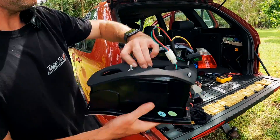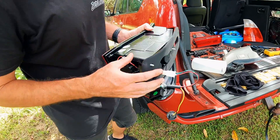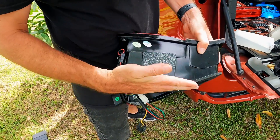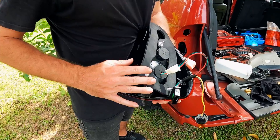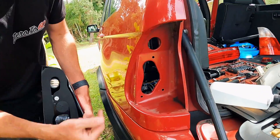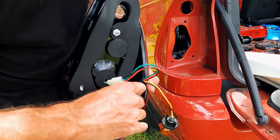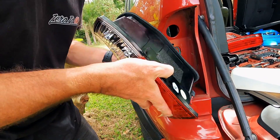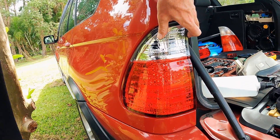Keep in mind it is only this rubber seal that seals it against water. If that rubber seal doesn't seal against the paint or body of the car, you will get water leaking in. Fit them up, try and get the rubber to sit on the plastic and make sure it's well seated before you put it into place - if you get a wrinkle or crease on there you'll have a water leak. The indicator bulb has to come up and through the top hole, so feed the wiring harness and indicator through the bottom hole. Make sure you take the tape off the wiring harness.